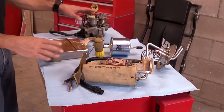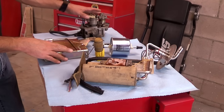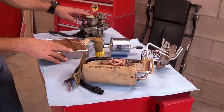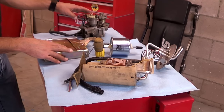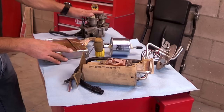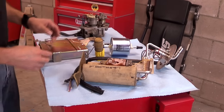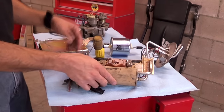Just a reminder, we're focusing on the mechanical part of it. There will be other factors that affect the pattern of the injectors and how much fuel is required as you accelerate or decelerate, but we're not covering that here. Last but not least, in your fuel pump module you're going to find your fuel tank sending unit. The resistance changes as the arm goes up or down.